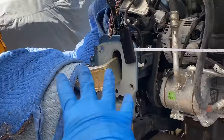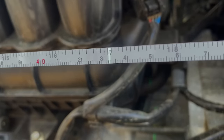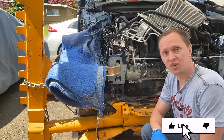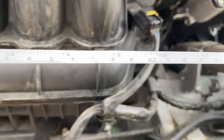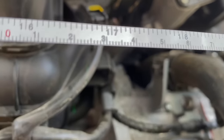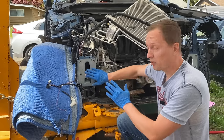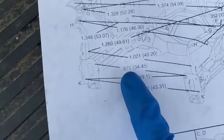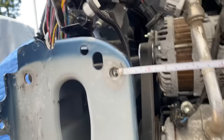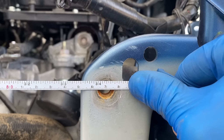With the chain fully relaxed and no tension, after the first pull we are right at 432.5 millimeters — five more millimeters to go. After the second pull: from the center of a hole out to the beam we are at 437.5. Right on the money. Frame rails are back where they're supposed to be in relation to the laser beam. Let's take that hole-to-hole measurement to confirm — from edge of the hole to edge of the hole: 875 millimeters, right on the dot.